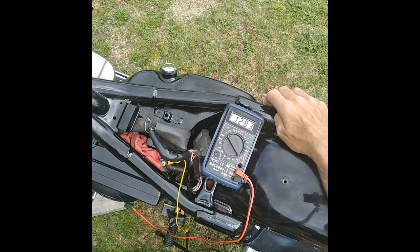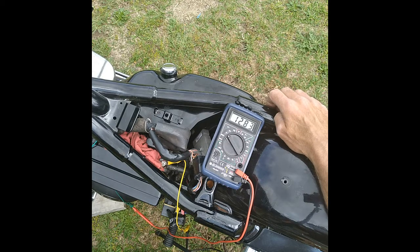So we're sitting pretty good. I had to take this battery out of the other bike because that other battery is newer — it's got a newer date code on it, but it's fried. Overcharging. It'll basically cook your battery, it overheats the battery. Usually due to a bad ground from the regulator body, because the regulator shunts the excess through the ground. And if it ain't got a good ground, it can't shunt it.